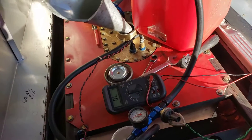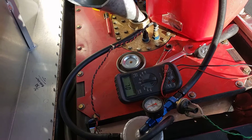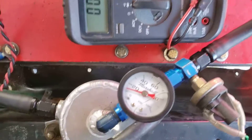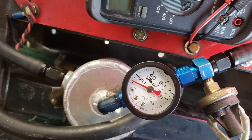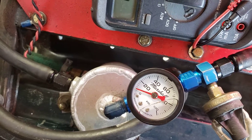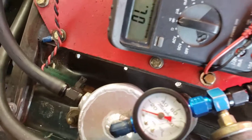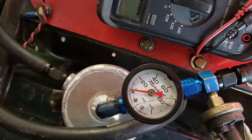Here I'll try and show you what it's going to work like — think of the beeping as not having a light on. So I've got the pump running, sitting at about 12 psi. Now the tank's starting to run out of fuel — there it goes, and it just shut off. Kind of a cool little 'hey, you're running out of fuel, come on in.'